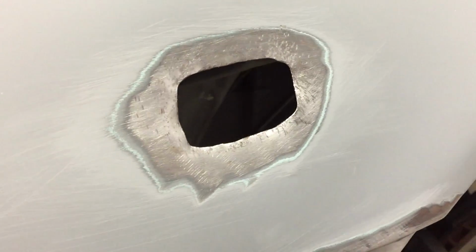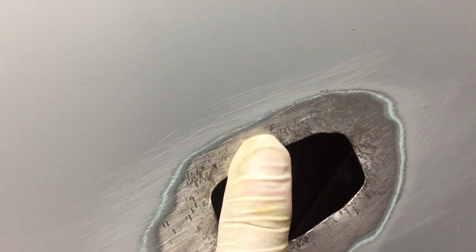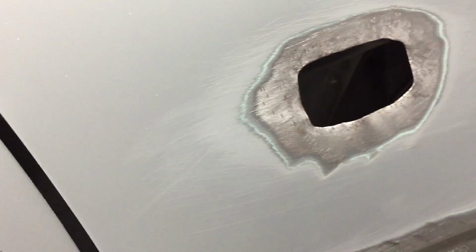Yeah, as you can see here, we've hit this down. Now the only problem is, I've noticed that the metal seems to pop back out very easily when you pull on it. It wants to come back to its natural resting state, just your finger pulling on it. When you push down on it, it springs back. So I think we're going to have to cut some little relief lines here, so it will bend out and it will hold that shape when we push it down.